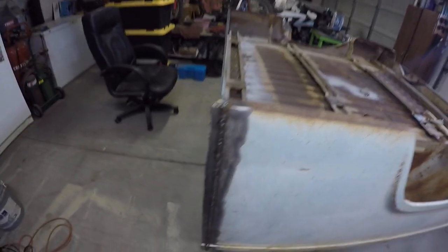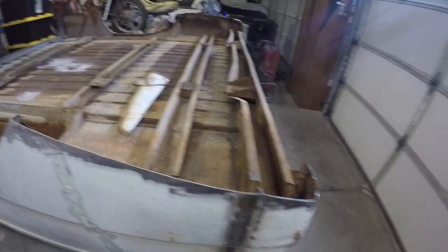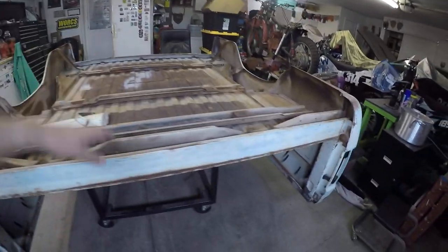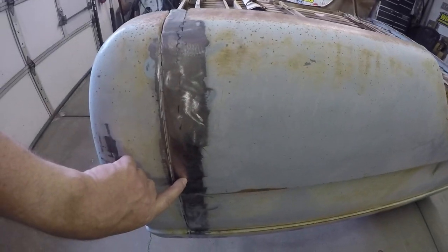I know it's upside down, but I got all the welding done. This side is done — a little bit of grinding here. I did the back half lower bottom cut. I know it looks weird upside down, but that's for pre-runner trucks so the back of the truck goes through a ditch and you don't catch on it. This is all polished up, ground up — looking pretty good. Every once in a while you get a little hole that you'll have to fill, but it's getting cut off like the other side so it doesn't really matter. You just spot weld it in. Same over here — this one's all ground down.